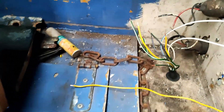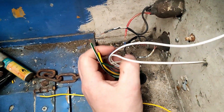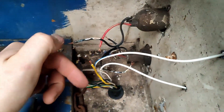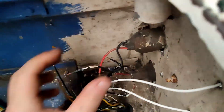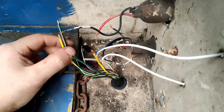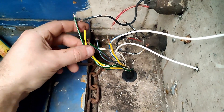Here's the back of the tub, right-hand side. I've got all my wires coming up here — these here for the reverse fog light, just stuck through there for now. Got one for the number plate light. Ideally these would be long enough that you can tuck them in and have all your connections inside this box accessible through here. Mine currently are not, and further down the line I might change them, but it's better to have these wires long enough so they can be pushed back down. These just need Lucas terminals crimping on, and that's how it's going to join up.